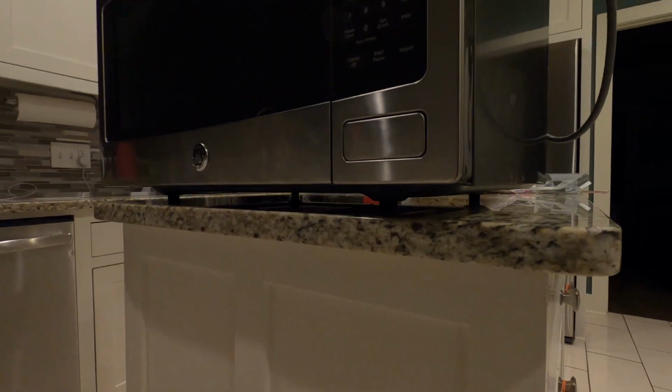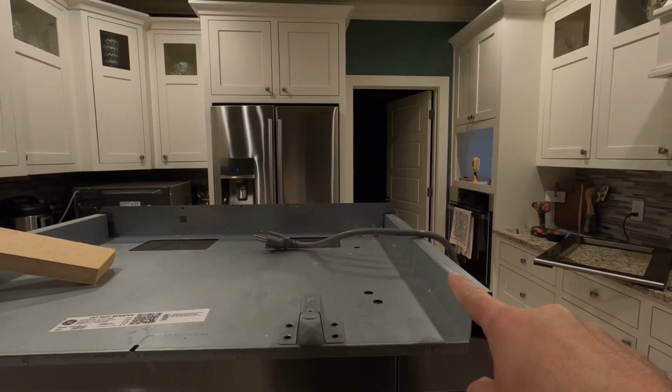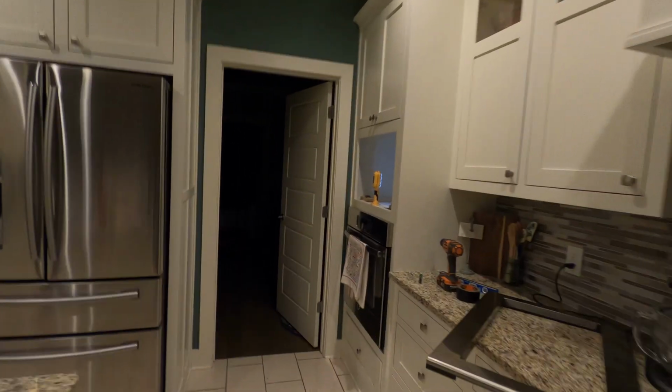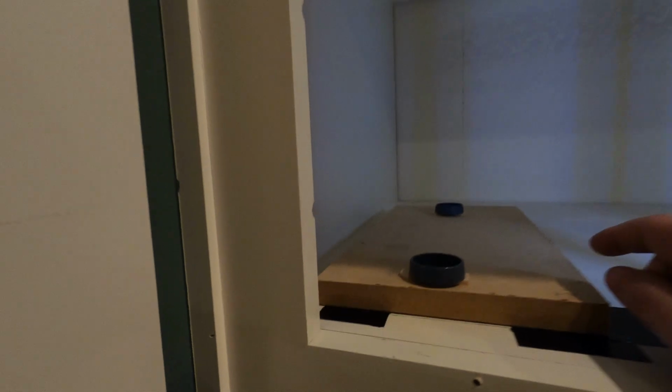So I set out to keep this GE frame and come up with a solution to insert the new LG microwave. As you would expect, the bottoms and feet of microwaves vary. This was the case between the GE and the LG, and therefore I couldn't use the existing bottom bracket, which is compatible with the mounting frame. So I had to build a new base for the LG to rest. The base had to address both height, as well as ensuring the microwave doesn't slide when pressing buttons.